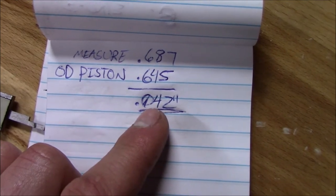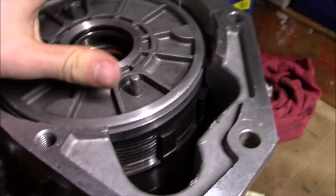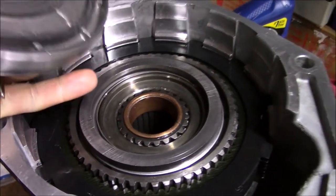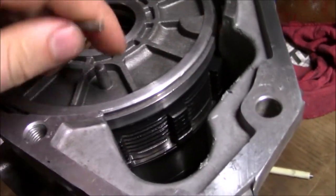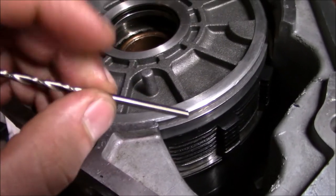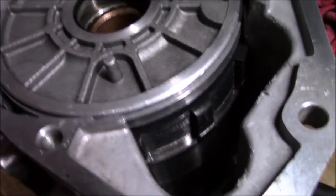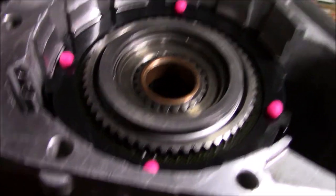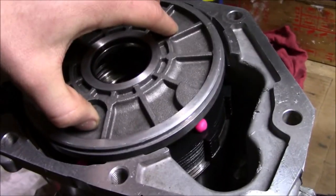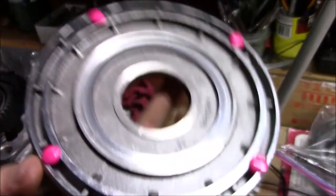The reason I want more than that is because my builder says he has smoked direct clutches at anything less than 120 thousandths. So I put in the thickest single spacer available, which is a .245, and put the piston back on top. Let me show you the quickest way to reference this — I have a bunch of different drill bits to tell me how big the gap is, making sure it isn't getting cockeyed. Then another way: take some Play-Doh, push the piston down over the top until it's bottomed, and measure the height of the smashed Play-Doh balls — it's essentially treated as plastigage.